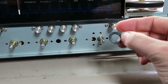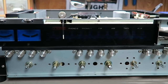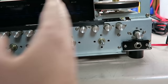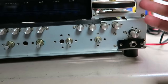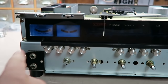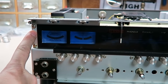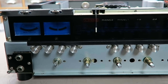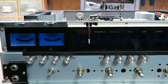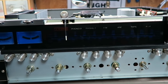Now to get the plastic dial off: I remove these two end-cap screws — this end cap just keeps light from seeping in — plus the two small screws here. Then work one end with a small screwdriver, a guitar pick, or an iPhone screen removal tool, pop behind it and work your way around. The adhesive glue will come loose, and typically the vellum will tear and come out as well, but we're replacing both anyway.